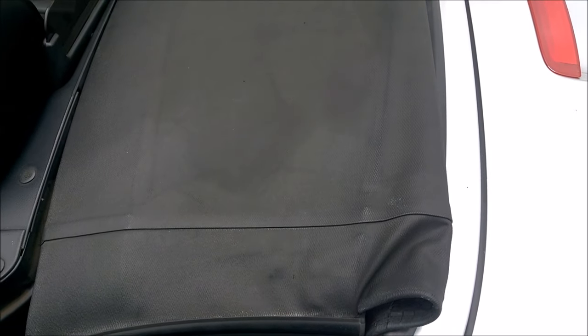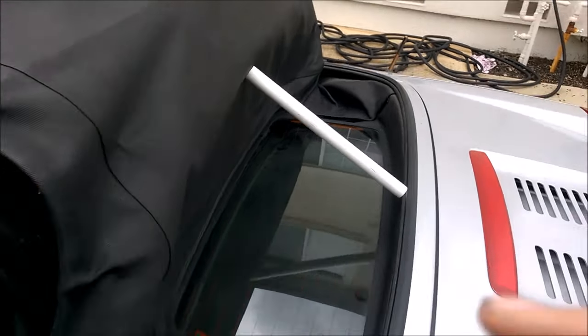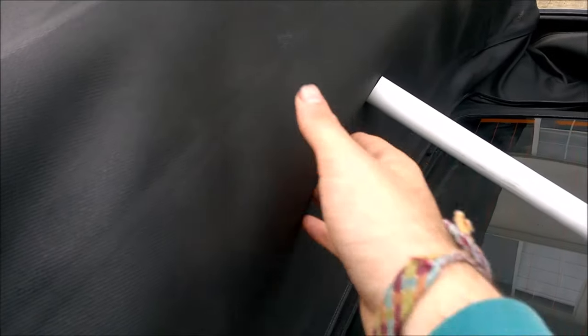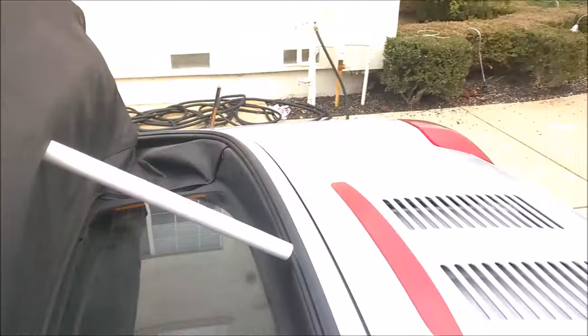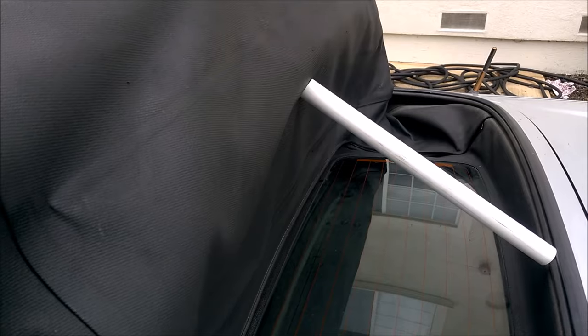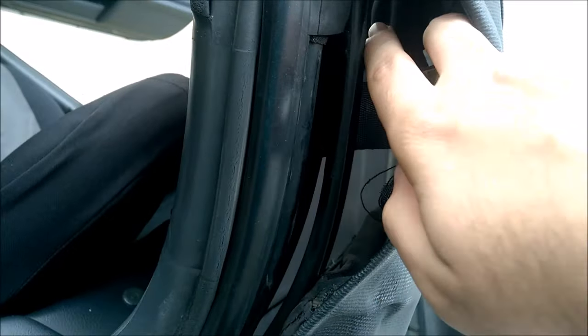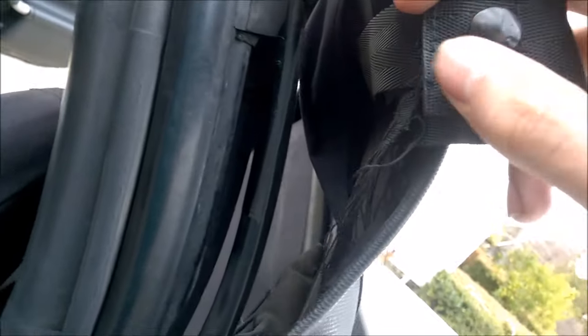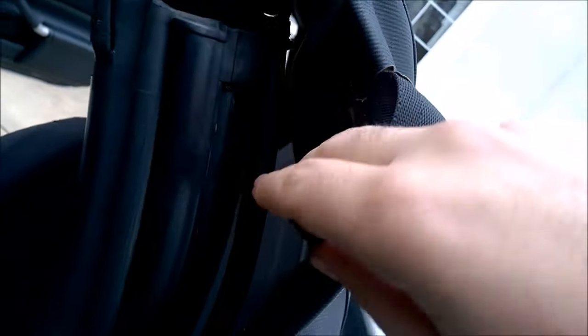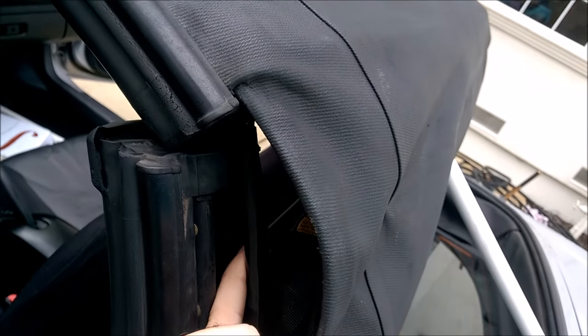First things first, I'm going to cut the video and lift the top up to the position it should be in. The top is up where it's supposed to be — you're just going to support it off this back piece here onto the bottom of the two straps that go along the top. It's going to take a minute to show you what a wrongly installed top strap looks like, and this was how mine came, which is why I was getting the ears even though my strap was technically installed. This is the little strap that the top strap connects to using this little stud — there's the strap itself. This little part right here is supposed to be going along this bar, going around it and then coming back out.